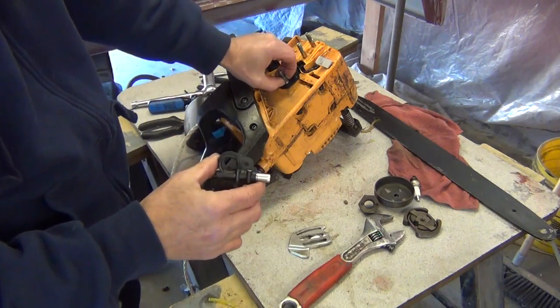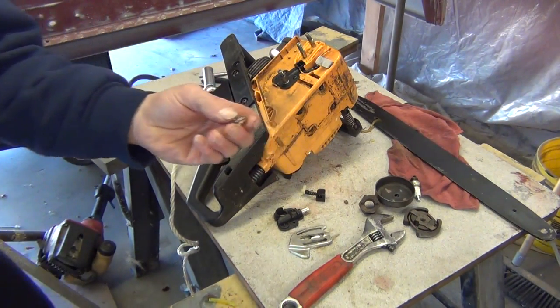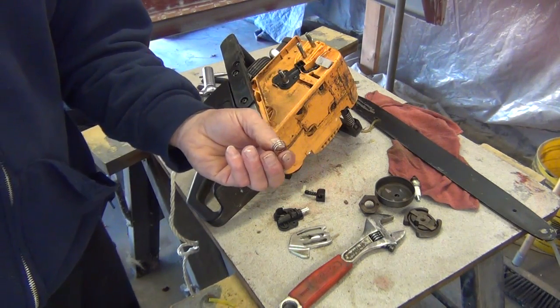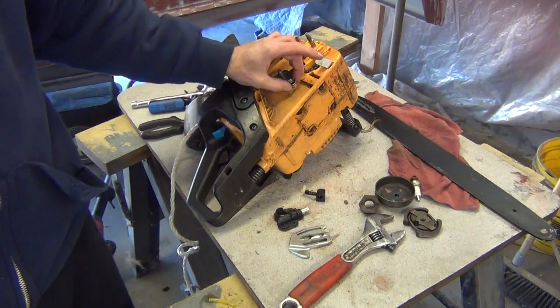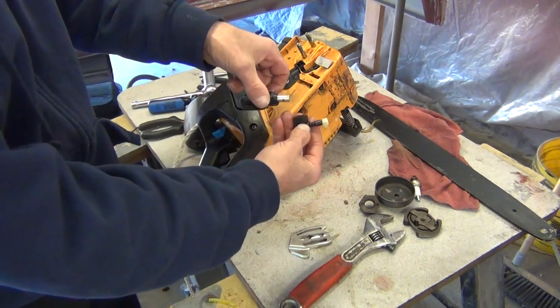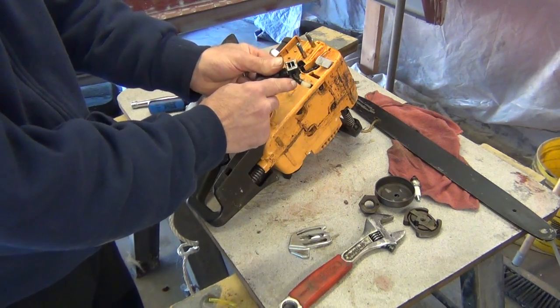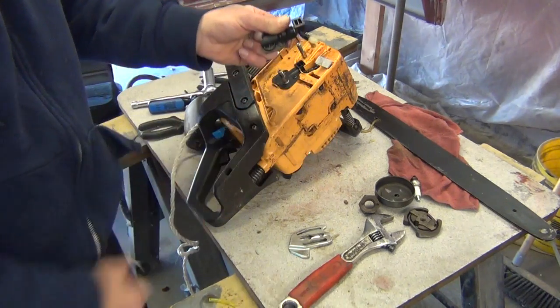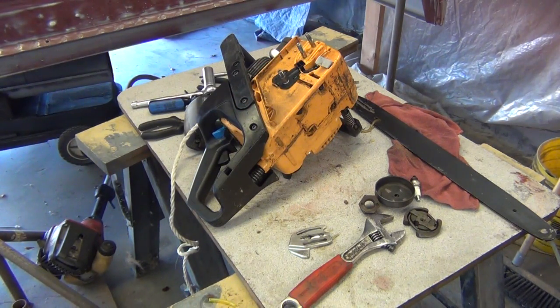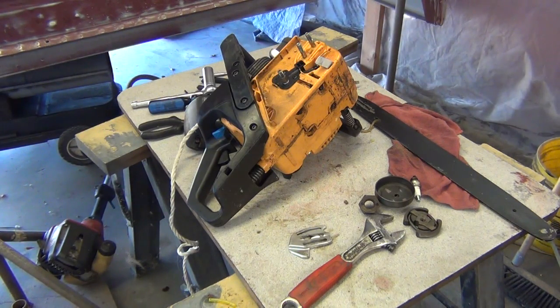So, and there's like a worm gear. It's a spring that comes with your kit. I didn't replace it because mine didn't need it. It is metal, so it's probably not going to ever go bad on you. I guess they do. They give you a new one when you buy a pump, but when you take the pump off, it just slides over top the crankshaft underneath this pump there. And that's pretty much all there is to it. And of course, you get this new whenever you buy a new pump. And you'll get two different lines here. I guess different chainsaws use the same pump, just have a little bit different of a line. Like I had another one came with this new one that looked like this right there. That just came extra with the kit, probably for a different type of chainsaw. But that's all there is to that.